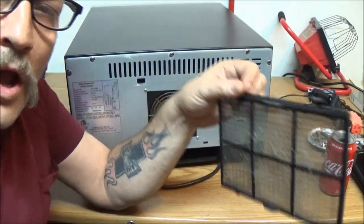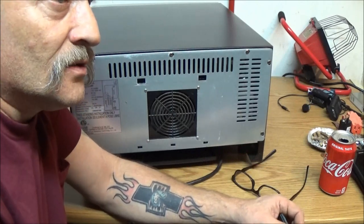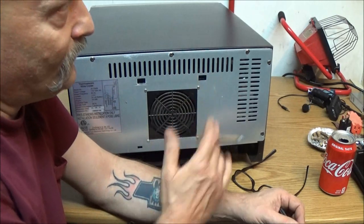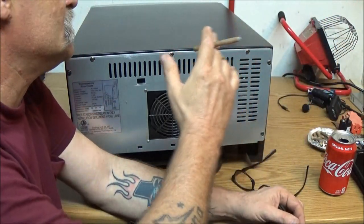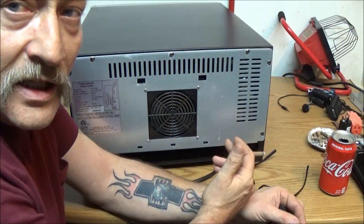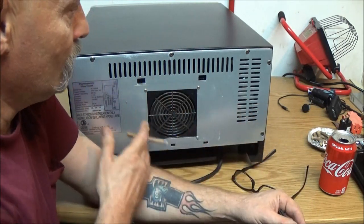Since it doesn't have a pump, a lot of cooling depends on how hot or cold your house is. If your house is 80 degrees inside because your air conditioner quit, this thing is not going to work. The hotter the ambient temperature, the hotter it's going to be inside. It's not a refrigerator — it doesn't refrigerate, it just sucks the hot air out. So if yours doesn't go below 55 or 56, you're okay — there's nothing wrong with it.